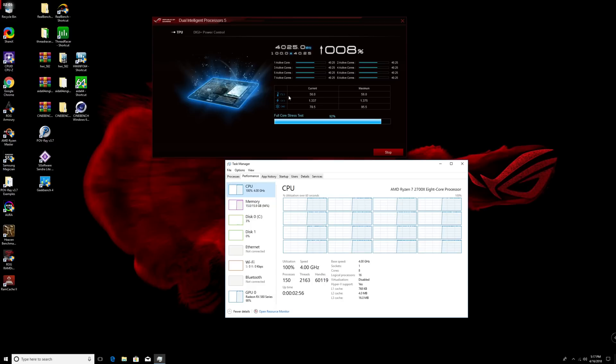You can check the information shown directly here — the temperature being read from the die of the CPU, and the voltage being applied, which we automatically increment based on our own internal analysis of a large number of Ryzen 2 processors, done safely and efficiently. You can also see a real-time representation of how much power is being drawn, which corroborates and aligns with the actual total heat output by the CPU as it gets overclocked.